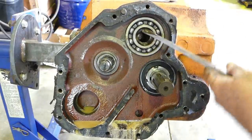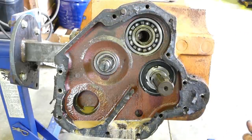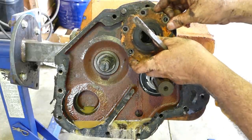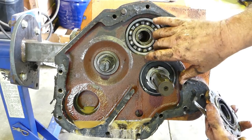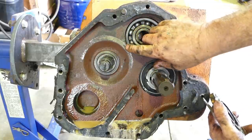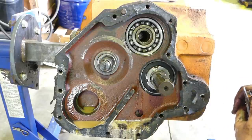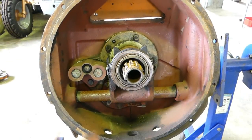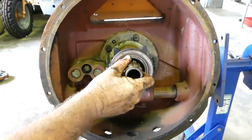This bearing is used, and the shims on the back were used to just hold everything in place here. We may need to machine up a spacer. There's two bearings together and then this sits up the back there to support it all. We'll probably have to build a spacer to come in behind here just to hold that forward where we need it. You can see where the bearing has collapsed at some stage and the gears chewed into the back there — but these are old tractors, who knows what's been done. We'll wind her over and come to the front to remove the throwout bearing.